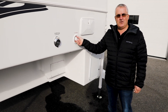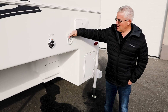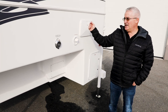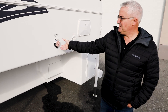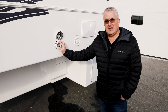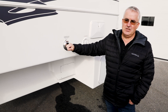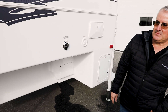You have your city water connection here. If you are at a campsite that has fresh water hookup, you just connect up to this spot right here and it bypasses the water tank, pressurizes the camper, and you'll have water flowing from all the outlets inside the unit. There's also a 30 amp power cord connection here. The camper does come with a 30 amp power cord, so if you're at a campsite that has full service, you can just hook right up and have 110 power to run things like your AC and your microwave.